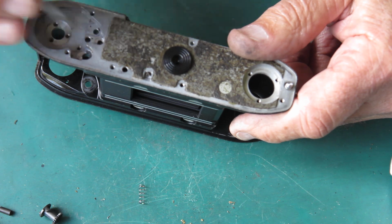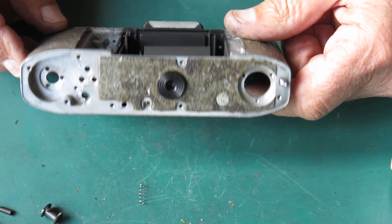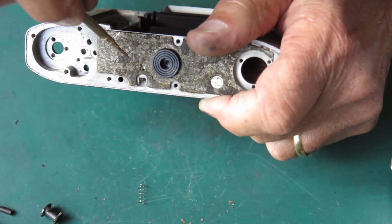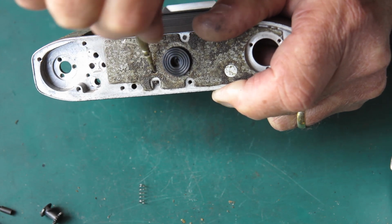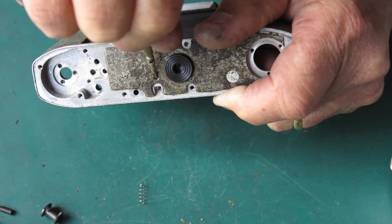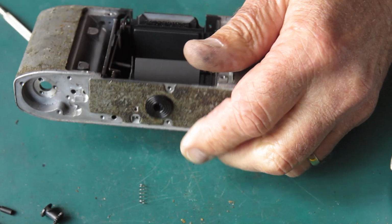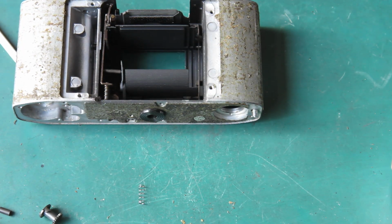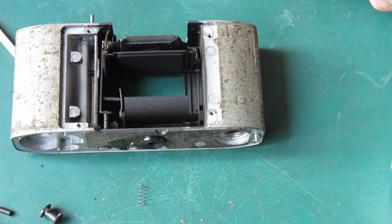Back to getting this control out, there's a lock screw here which locks the position of that. I need to get that screw loose, and then the adjustment screw will turn. Oh, that's reluctant too. I'll put a drop of naphtha on there. I know someone's been playing with those because the adjustment screw is out. I'll be back with another screwdriver.